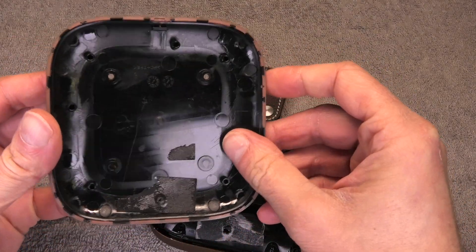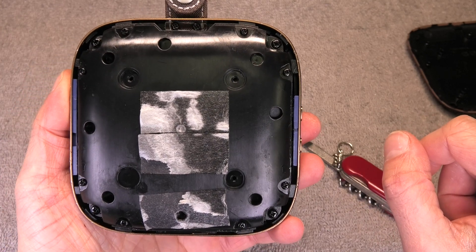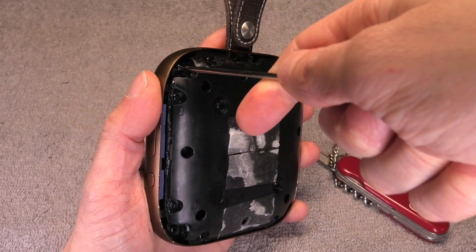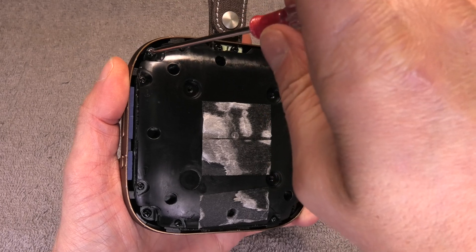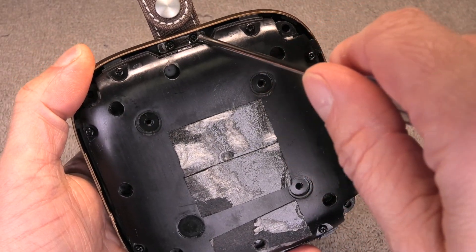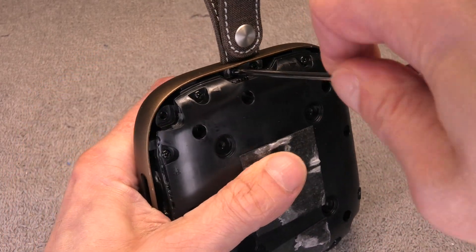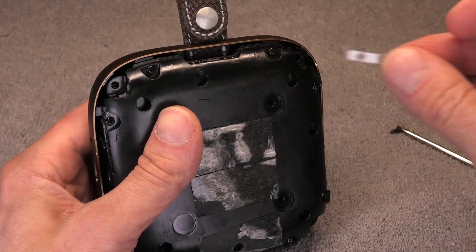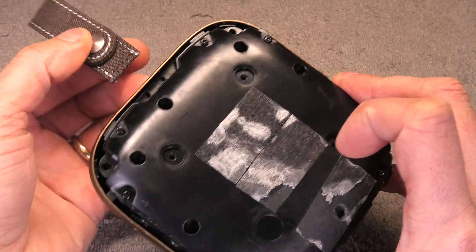See the adhesive tape there. Now we see a whole bunch of other screws, and for now we just remove the four screws that are in the corners. Afterwards we still have the fabric tab on the top — there are two screws holding that in. When you remove those screws, make sure you don't lose this little plastic piece. Then we can just easily pull the fabric part out.